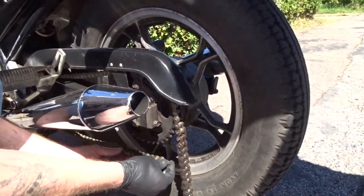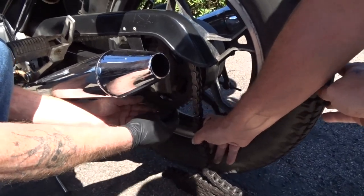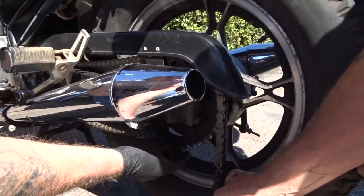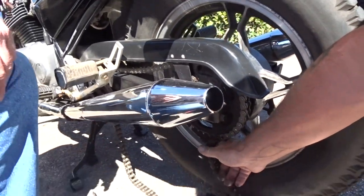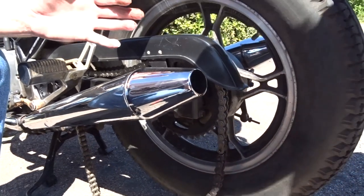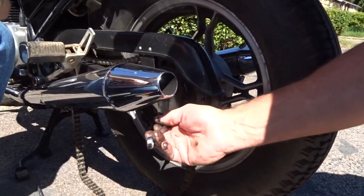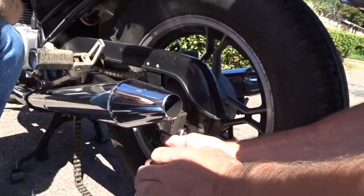You've got to pull it as tight as you can on that bottom sprocket. Next one this way if you can. I can't really see what I'm doing. Needs to go forward a bit more, doesn't it, that wheel? That's going into that one. Yeah, see, his chain wants to go into this one here. I can't see, there's an exhaust pipe in the way. If I can just loosen this side off, push the wheel that way. Do you want a 12mm socket? No, I've got a 12mm socket. Ain't got to go much more now, has it?